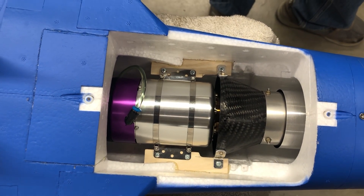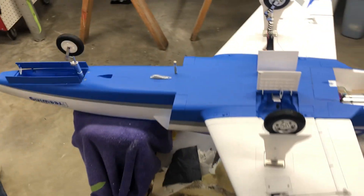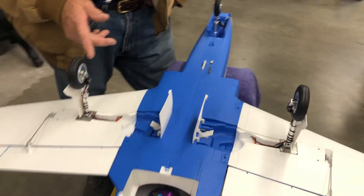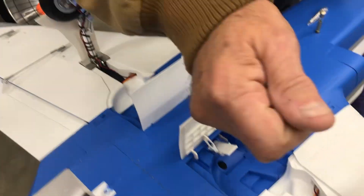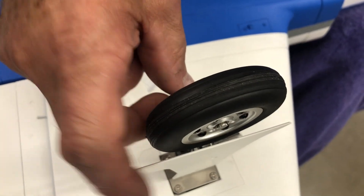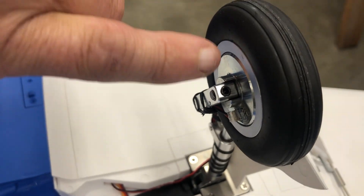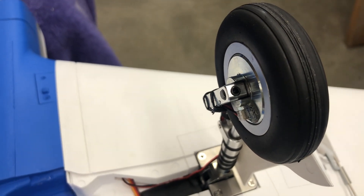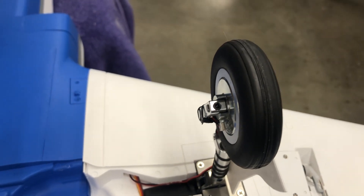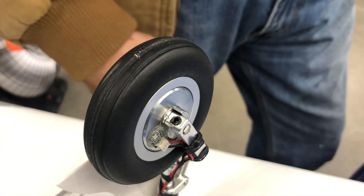As far as the wheels and brakes go, I thought I could just slide on a standard set of JPs or LDTs, but you really can't — because if you don't do a modification here, the tire is gonna rub up against the outer gear door. You've got minimal clearance there, and I gained about the same amount by milling the slot there. Doing the slot brings it inboard just a little bit to give you clearance. I feel if you don't do that, it's gonna rub on the outer gear door.